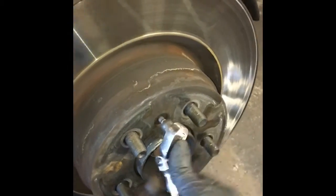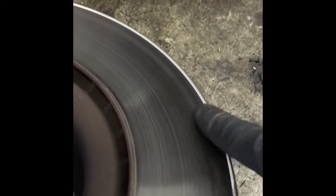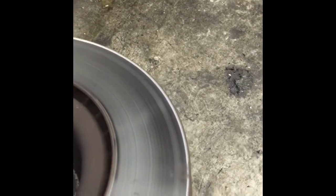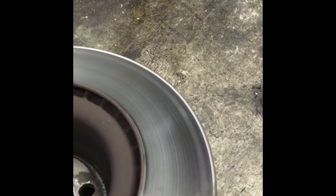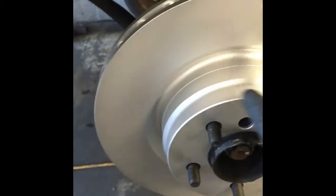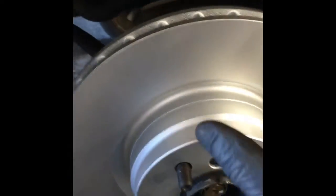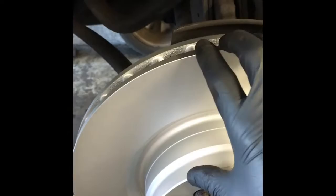We'll take our rotor off and we're going to replace it with a brand new rotor. For European cars, about 80% of the time you end up changing the rotor anyway because they develop these really large grooves. They work pretty easily because they're very soft metal and they wear fast — part of the reason why they stop so well is because of that soft metal. But they do wear out fast and most of the time you end up just replacing the rotors anyway. One of the keys to doing a really quality brake job is when you put your new rotors on, try not to touch the surfaces with your hands. The grease and dirt that gets on them when you start breaking in develops spots in those areas, so the key to not having a squeaking brake is to keep it clean.